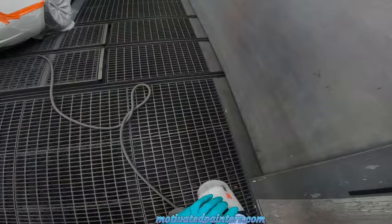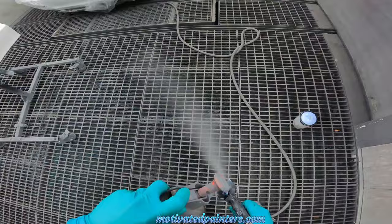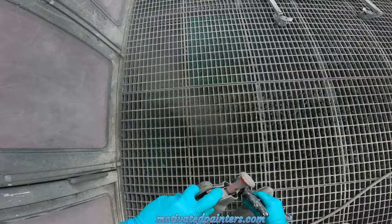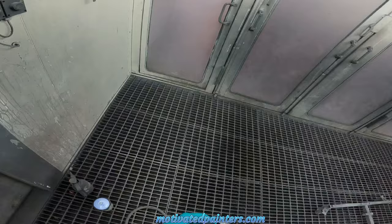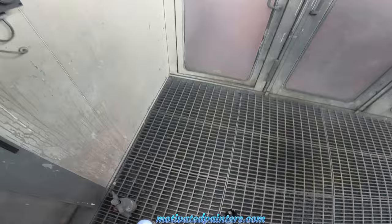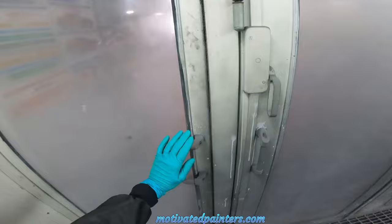Let me show you how I do a little bit of fast cleaning here. Just take that off, some water cleaner, rinse that out very quickly. That way when you go and clean it in your gun wash, you don't destroy your gun wash — you have nice clean solvent to work with. Lower the pressure, pull the trigger — boom, your gun's basically clean inside. Now you just have to rinse it off.